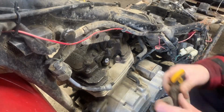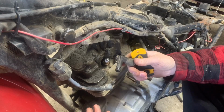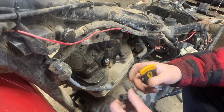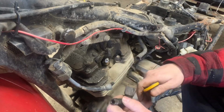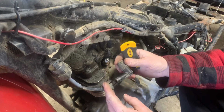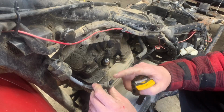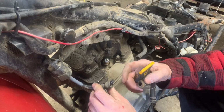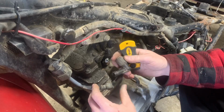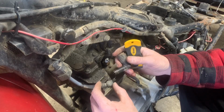Okay, so I look at that falling apart like that as a good thing. And I know you're probably thinking, what the hell are you talking about? Well, here's why I think it's a good thing. If this machine died and they couldn't get it to start and this is all that's wrong with it, then things are looking up. But at a closer look, all that's really here is half of a broken wire. So there's really not going to be much contact there, even if it was touching. I honestly don't think it'd be getting a really hot spark.